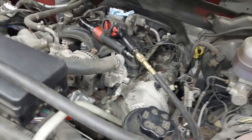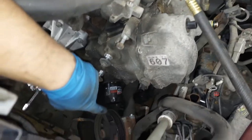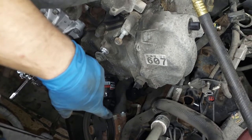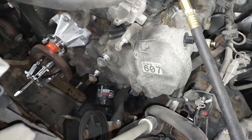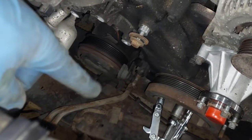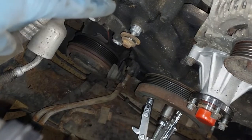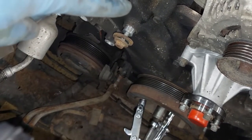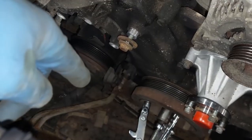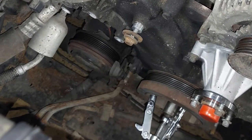Here's a quick rundown of where I'm at right now. I've got the power steering pump removed — those are held on with 10-millimeter bolts, one towards the pulley and two in the back, the lower one being a stud with a wire on it. There's a bracket holding the power steering line, and a similar stud with a bracket holding the cooler lines. Underneath the vehicle towards the starter there's a 10-millimeter bolt holding that bracket which supports the wires for the starter as well as the cooler lines for the transmission. I had a little difficulty getting that off, but once I did it gave me better access to remove the crank sensor wiring, which was pretty difficult to get to — I got to it from underneath the engine.